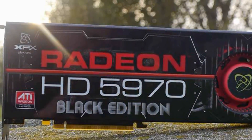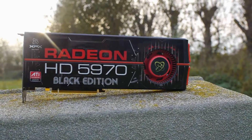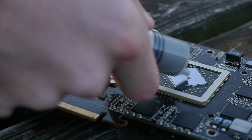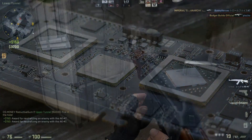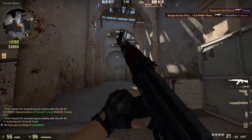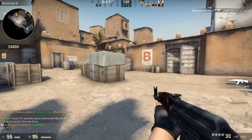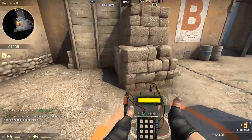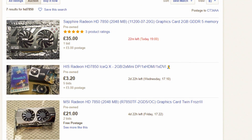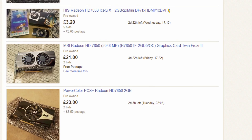In conclusion, it may have been a short video, but I did spend a good few days using solely this card. Yes, it is a step down from my usual R9 285, but it's cool and quiet, topping out at 75 degrees C on both chips with the fan only spinning at 35%. It ran every game I needed it to well, and I can't fault the price to performance — you get two amazing cards for the price of one. They can overclock well, and in general they're a fun Crossfire experience. Realistically though, for anyone spending more than £25, it's not worth it due to the power requirements, and for just £10 more you can get a GTX 660 or HD 7850 which are much newer and still receive driver updates, unlike this card whose most recent drivers came out around last year.